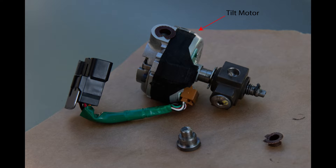This is what the tilt motor looks like when it's outside the car, and here is the E-clip that I mistakenly left off when I did my first repair. This is the tilt motor nut, and this is the pivot pin that goes into the side of the tilt motor nut to hold it in place. The tricky thing about the pivot pin is that it's not a regular bolt with threads — it basically just pushes straight in and pulls straight out when you're installing or replacing it, so you need special tools to pull it out or push it back in.